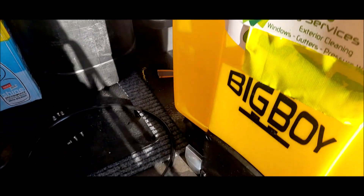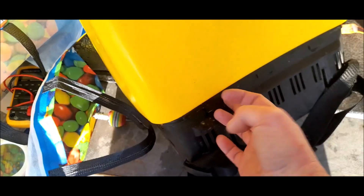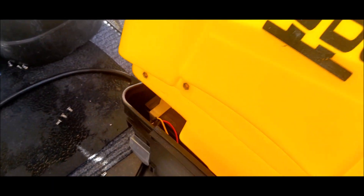On the rear of the backpack you need to remove the back plate, which comes off with one screw at the top and then pulls down. On the back you've got two screws again hidden under little rubber flaps. Once you've done that, you need to lie your backpack on its back or lie it up front and you should be able to pull it apart.